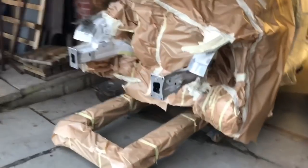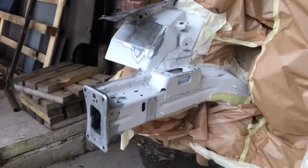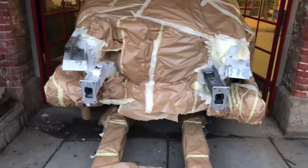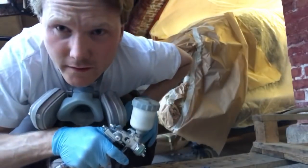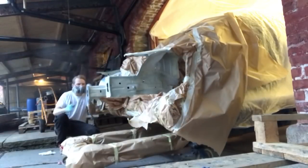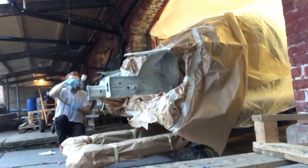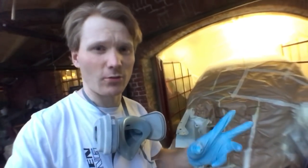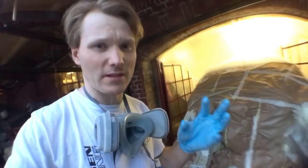Here we have my paint box today. As you can see it's now ready for getting painted. We're gonna put a little bit of epoxy and then the white color. What I just painted is epoxy - that's mainly against rust, but it's also good before the paint because it makes the paint more sticky so it's not coming off so easy later on.